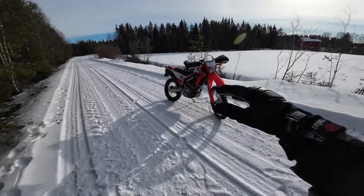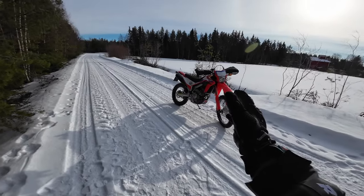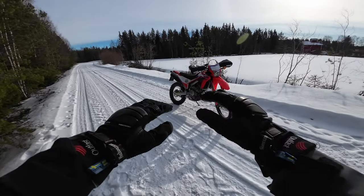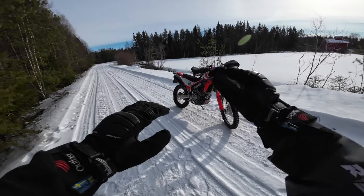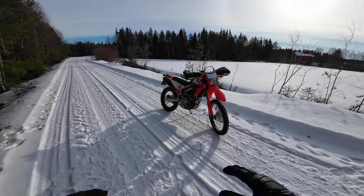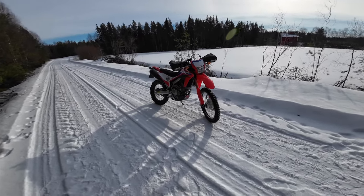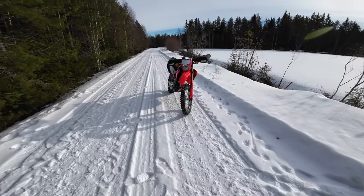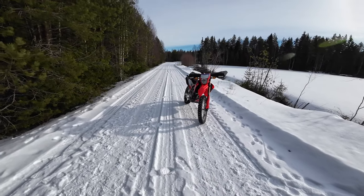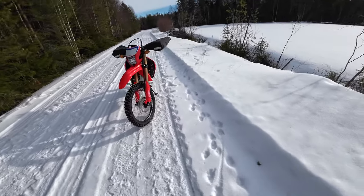Because the sag is not 50% or more than 50%, it's now 30%. It feels that much taller because of that. So 1 centimeter plus, the sag is not that much. It raises up the bike, and the feel is actually really nice. You can really comfortably ride it on some rougher terrain, I would assume. I don't have that today, but this is just a quick little test.